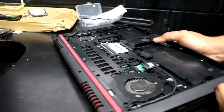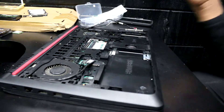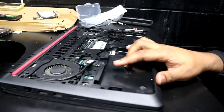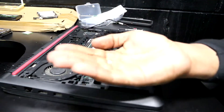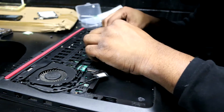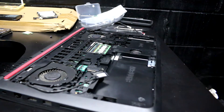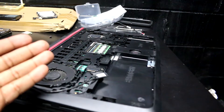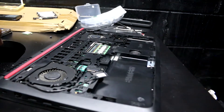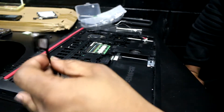Flipping this over now. The same screw for the LAN chip, the same screw for the hard drive, the same screws for the battery — they're all M2 times 5. The LAN chip uses the silver bolt that came with it, so I'll reuse that. We're going to snap in the RAM chip — it goes in like so and clicks in. To keep this video shorter, I'm putting everything back into position. We have the hard drive, the battery, and the Wi-Fi chip all sitting in place.